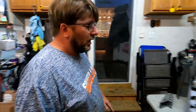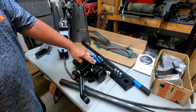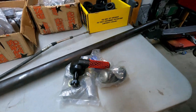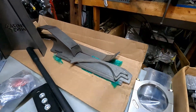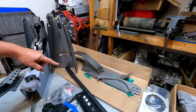I've got a blue top ported for hydro assist — we're going to put hydro assist on this too. I've got a high steer arm kit; I didn't bring the arms out. I'm adding a truss to the Dana 44 in the front, and my buddy John Christian is going to help me with that and welding up my axle tubes.